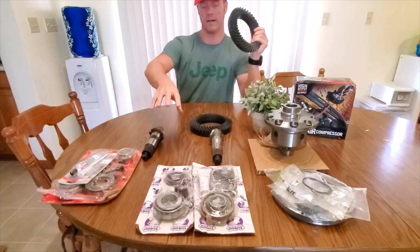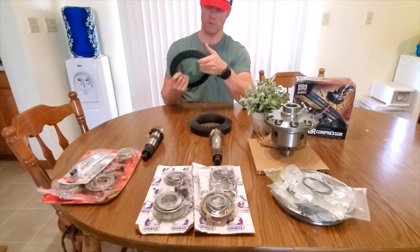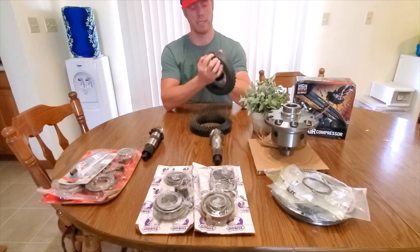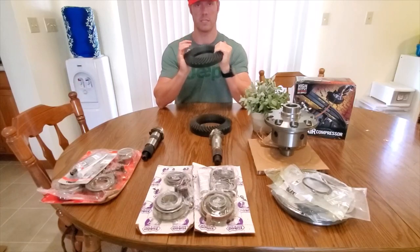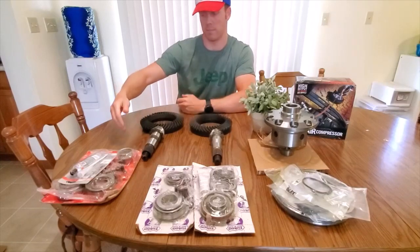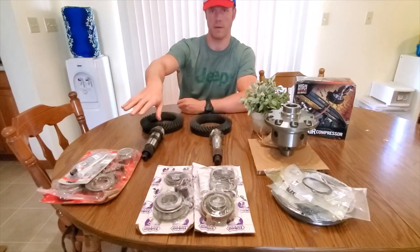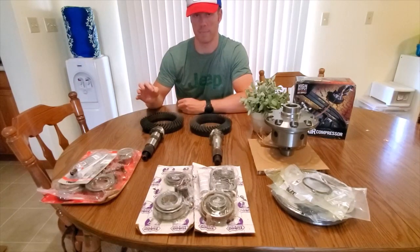These are all Spicer parts. Don't let the Yukon branding fool you on some of these gears. If you look at where the gear actually has the embossed serial numbers and tooth count punched in — that's all Dana Spicer stuff. The Spicer is more of the hardware part of the Dana axle company. The Spicers actually use the same Koyo USA-made bearings that Yukon uses. So whatever you're buying — Yukon or Dana Spicer — they're all made to the same spec and they're very well made.